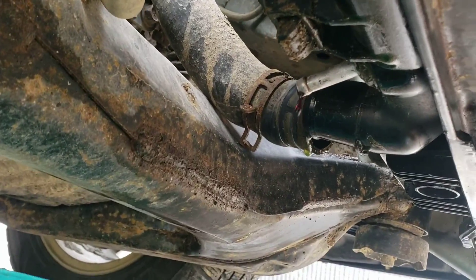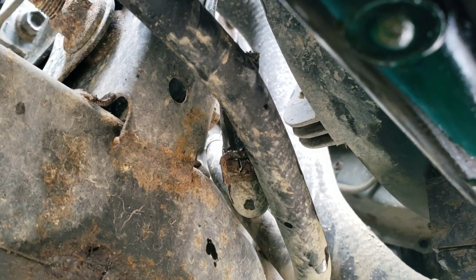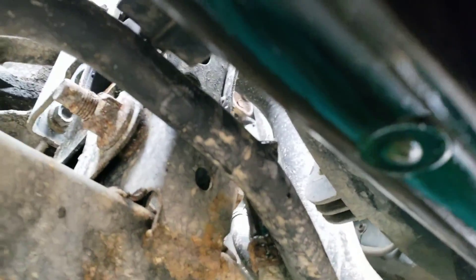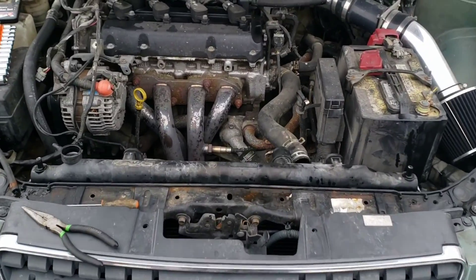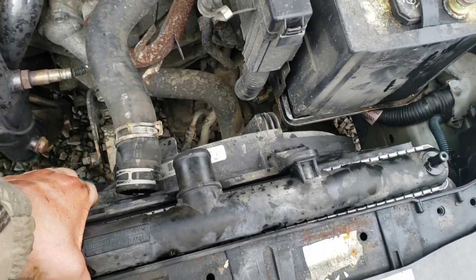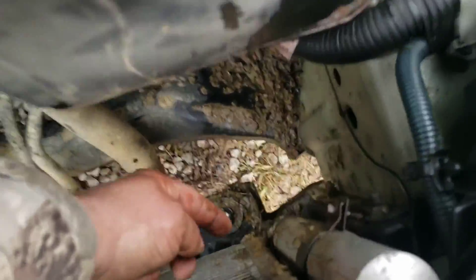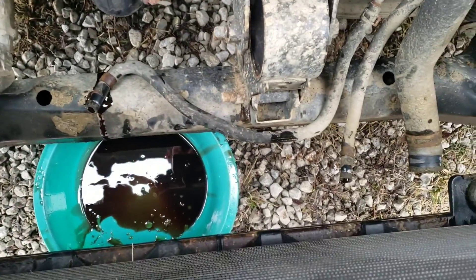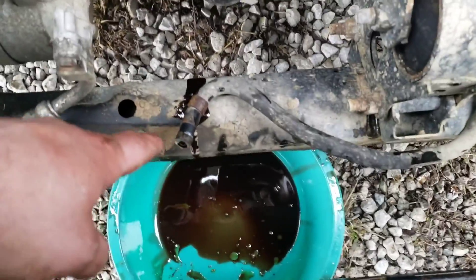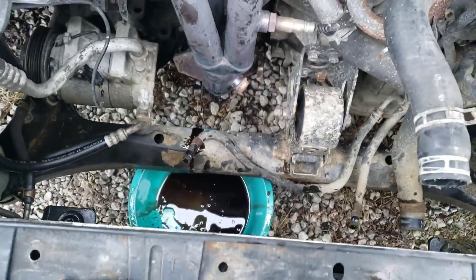I popped the first one off — you can see the red, but that is in fact transmission cooler. So I've bent the line up. I'm trying to do the same with the other to try to keep all the fluid from draining from the lines and the transmission. I've got both lines disconnected, so now I should be able to pull this up as a whole assembly. A little finessing and wiggling — so there she is. Came out pretty easy. After you pull that out, you might knock your lines down like I did. The radiator is out.